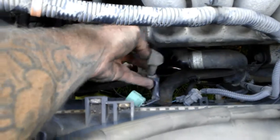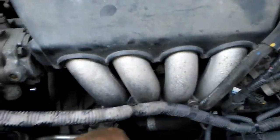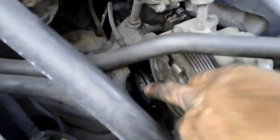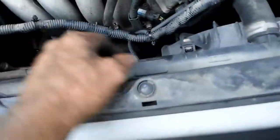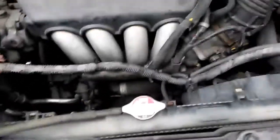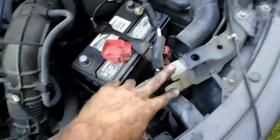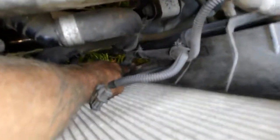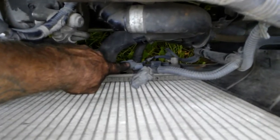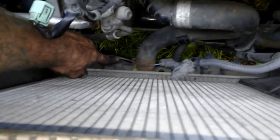It's a 10 millimeter and 14 millimeter for your tensioner, and a bunch of 10 millimeters across the top — one, two, three down low. I ended up undoing the hood latch also: three bolts there on the hood latch, two here, two here, and one way low that I could only get to from underneath. I had to undo the plug from underneath off the fan, and then undo the white clip that holds your AC wire on.